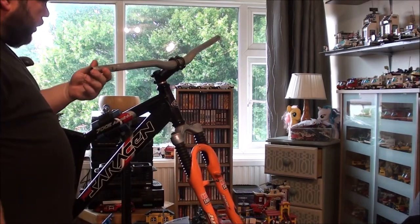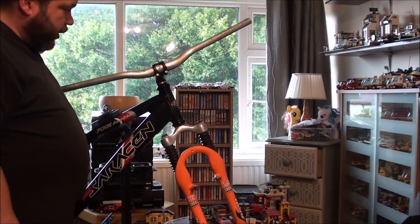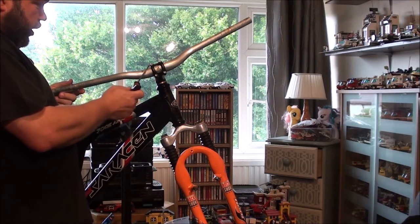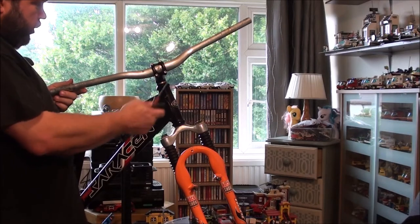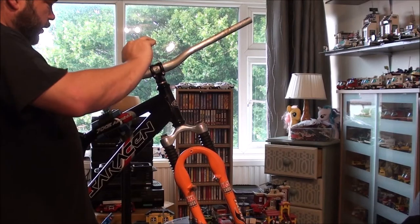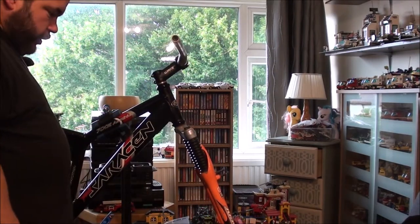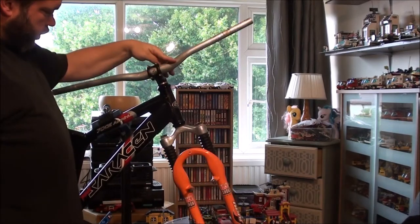Right, there's the handlebar fitted. I was so carried away talking about that I forgot to talk about what I was actually doing. When you tighten up these headsets you alternate the bolts. So if I start this one I then go to that one, then this one and that one — just keep going round until all of them are nice and tight. That one's all right, that one's all right, that one's a little bit loose but there we go. Make sure it's not too stiff — nope, that is perfect. It's starting to look like a bike.